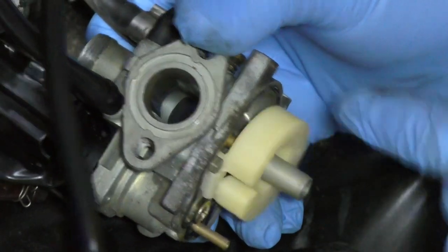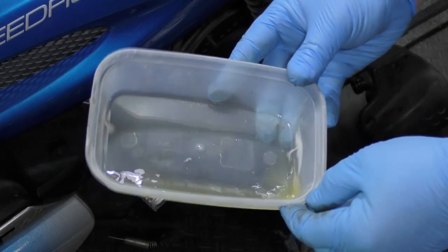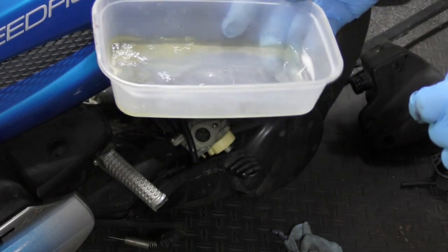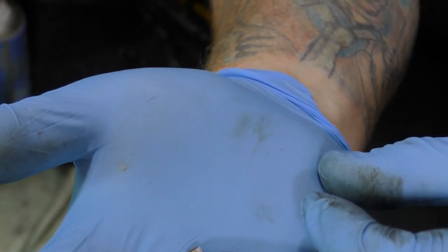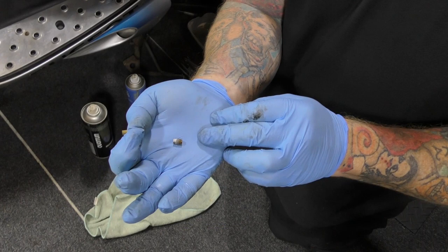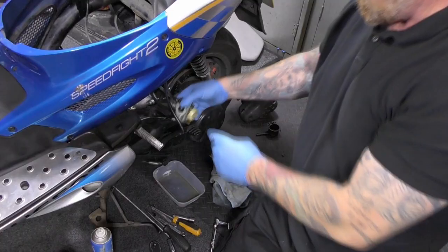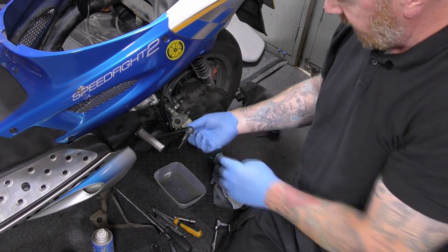You can see it's pretty yellowy and dirty. When I drained out the fuel — I've left it here because it's a water-cooled one — the fuel was really sticky yellow with little bits in it. That's all it takes: a tiny bit sitting in the bottom sucking up into the jet. Can you see the whiting on it? I believe that is E10 damage. It looks like aluminium rust on there — I know it's not, it wipes off. I'm going to blow all these through with carburetor cleaner, put it all back on, drain the fuel, put fresh fuel in, clean this up and see what she does.